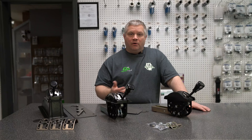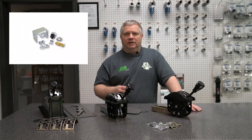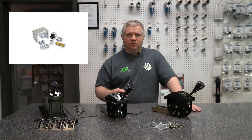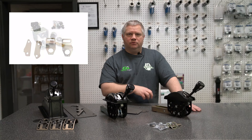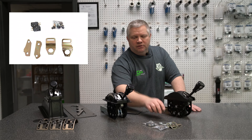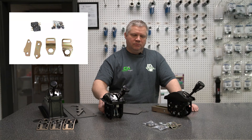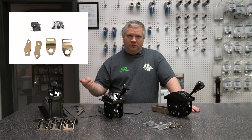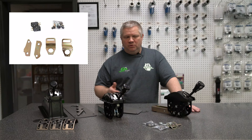The other thing we get asked about a lot is the safety switch kits. There is a park safety switch — it only allows you to start the vehicle in park if you have it wired. For what we do off road, we either don't need them, or we want the park neutral safety switch, which also has a backup light. It uses two micro switches and a series of cams underneath the body of the shifter — they go down in the body, tucked out of the way and not exposed to elements. These are not available for every application, which is why they're not in a drop-down on our website. You have to go to a different screen to grab the one that fits your transmission. For the most popular ones they are available, and for some of the newer shifters, they just have not finished developing those yet.